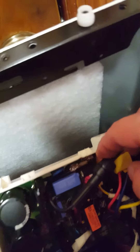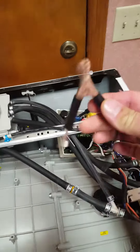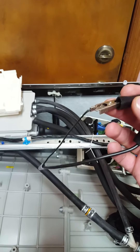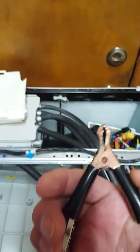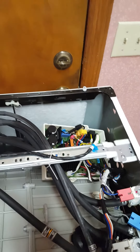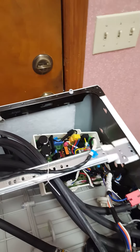I'm going to blame the lack of space and my antique soldering equipment for this horrible solder job. If you see where the fuse is without removing it, it was rather a pain to troubleshoot. I created this little rig out of an alligator clip, a big battery clamp alligator clip, and a small roach clip. I couldn't get them to grab on because of the lack of space, so I just bent the prongs out on the handle and that fit over it perfectly. I jumpered and bypassed the fuse, powered it up, ran it through an entire spin cycle with no issues, and the board didn't show any other burnouts.